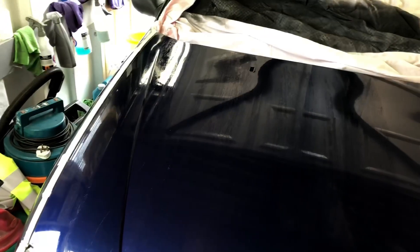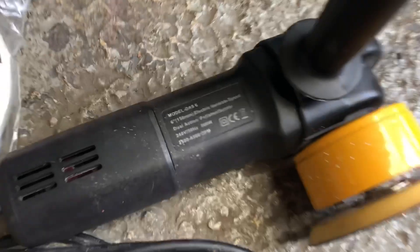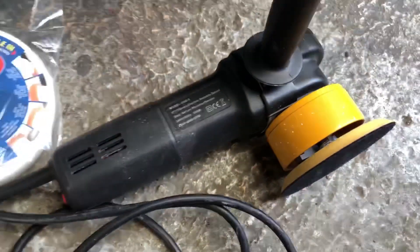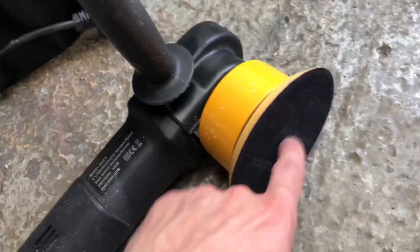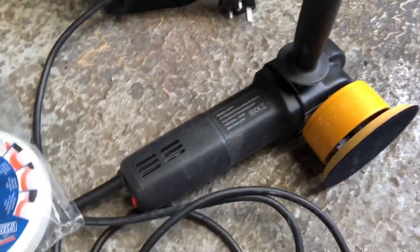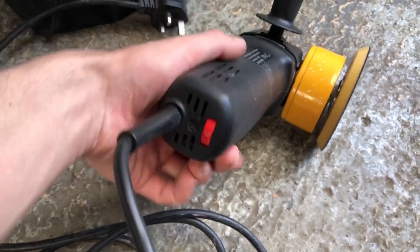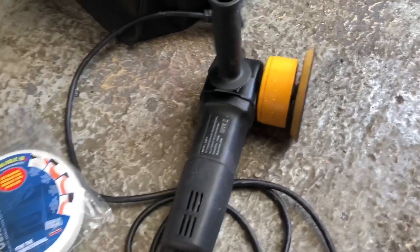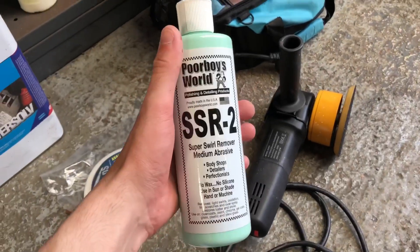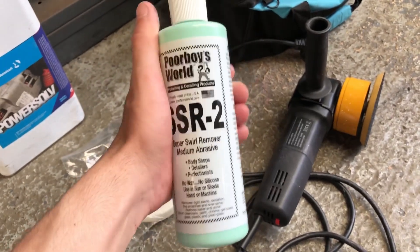I've just cleaned the bonnet off — all I used was just a bit of water and then a clean microfiber. This is the machine I've got — I'm going to put a link in the description below to it. I've got this pad; all it does is velcro so it just sticks to it. The machine has settings at the back for how fast it can go, from one to six. It's got this handle on it which you can change but I'm just going to use how it's set up as my dad used it last. As I said before, this is the cutting compound that was recommended yesterday, so we're going to use this.